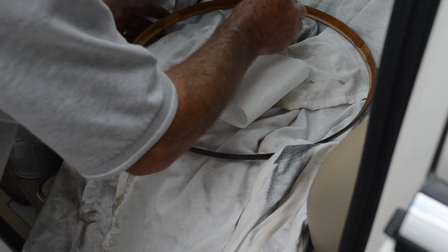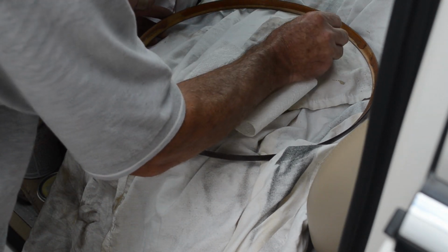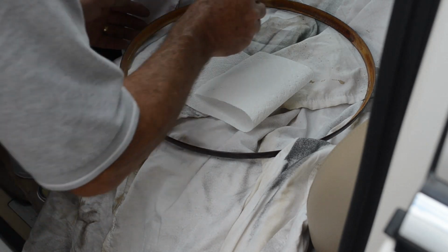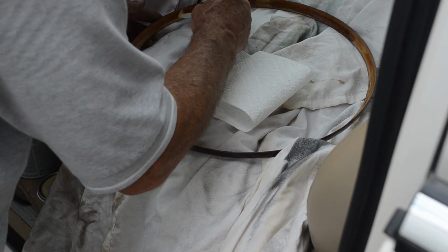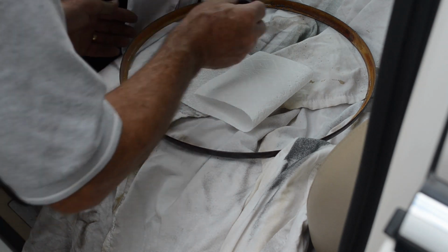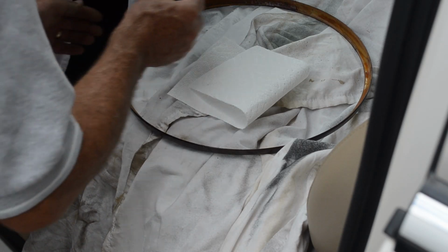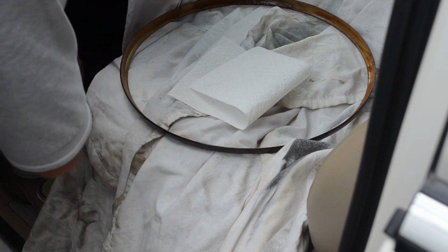So we've got both surfaces clean. We've got contact cement on both surfaces. We don't have to be in a hurry to put it together. Let them air dry a while. It could be 5-10 minutes, depending on the heat and humidity. Just don't let it bleed over into the afternoon because, no, just kidding.